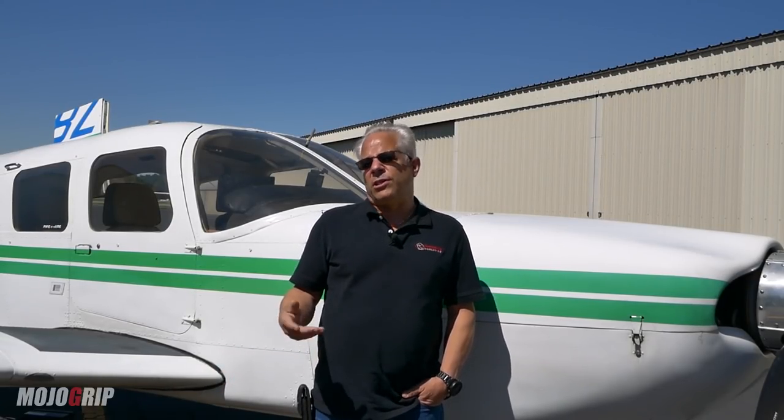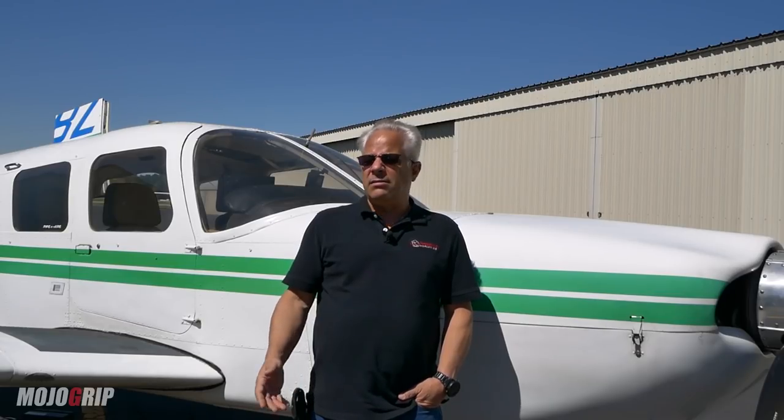I gotta say something really important. You need to pre-buy your airplane. Airplanes aren't like our cars, which we can pull over if something goes wrong, and there are so many things that can go wrong. And just because the guy says, "Well, it's been well maintained," that's not the same as a mechanic going through the airplane, checking the compressions, checking lubrication, checking that everything's rigged correctly, that the engine's good, the avionics, everything, and that all the ADs are complied with.